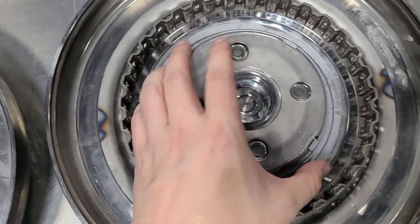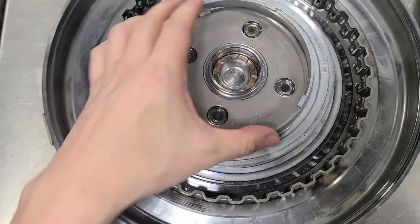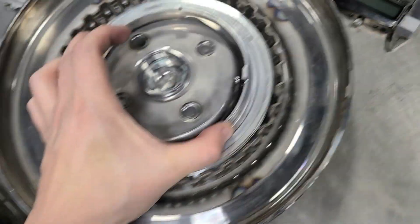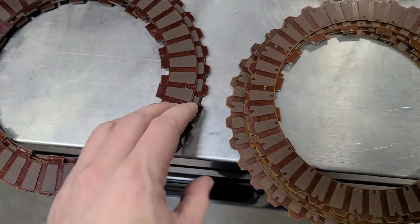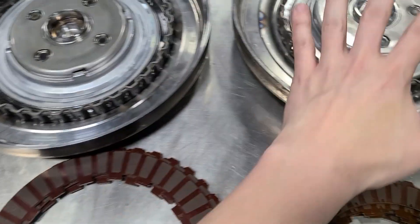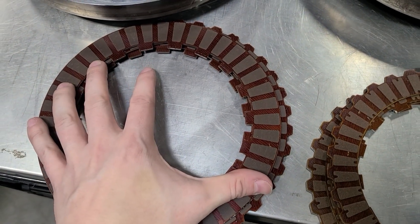The clutch stack is actuated by this piston, and the pistons are quite a bit different in size as well. The larger piston can supply a greater force against the clutch plates. This is one of the reasons why the bigger unit can hold a lot more power from the factory — the amount of pressure applied, plus the physical surface area of these clutches, is quite a bit more than the smaller unit.